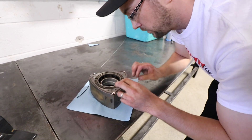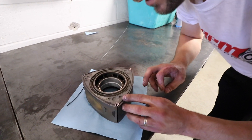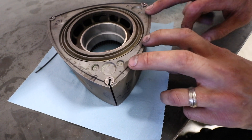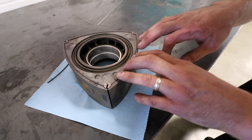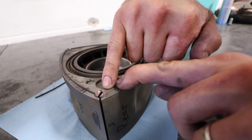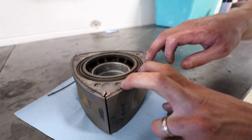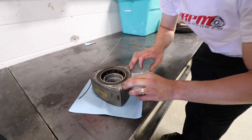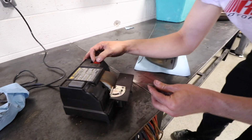You have to keep doing that until you get to the right length. So I'm going to slide that factory side in now — it actually fits just by taking that off. But here's the tricky part: it's too tight. I can already tell there's not enough clearance. You can see by me pushing up and down on this, I'm actually moving that corner seal — that corner seal is moving around. So that tells me there's not enough clearance right away; I don't even have to put a feeler gauge on there. So I'm going to pull this back out and take a touch more off with the sharpener.